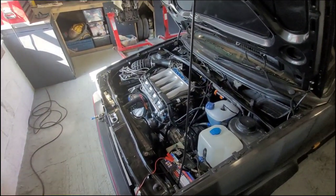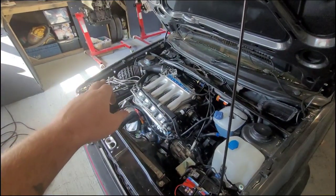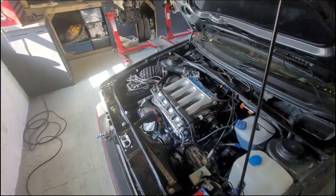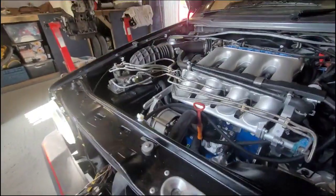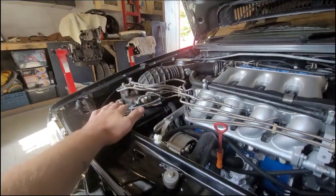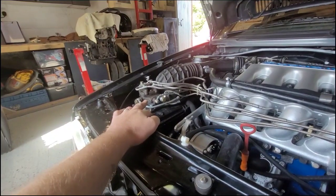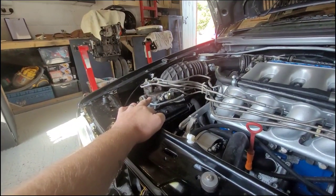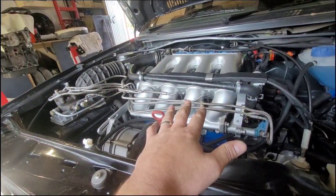Now, I spoke to him about a few things and he said, before I changed the injectors, look at the metering head. They are notoriously hard to change and pull apart. I don't know what's wrong with mine, but it wasn't right, so I put a spare one on there. Again, I don't know how old that is, but it's working, it's still got the same pressures, and we are running a hell of a lot better.